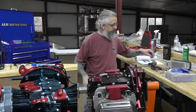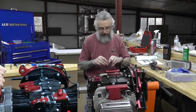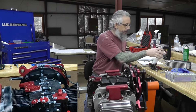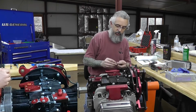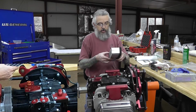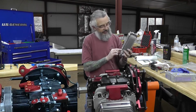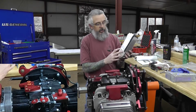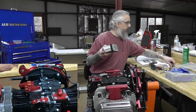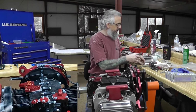Alright, so the next step is these skinnier, flatter, I'll call them spaceship washers. Again, little rubber gaskets. They pocket into these two recesses here at the top, and then there's a couple of dimple pressed orifices, we'll call them, cavities on the bottom of the oil cooler. The other two smaller holes are the bolt holes. So let's get some washers for the bolts.